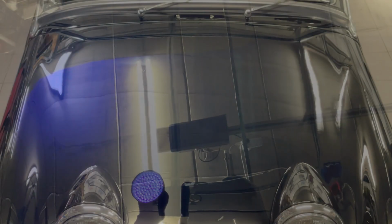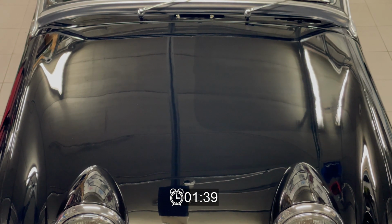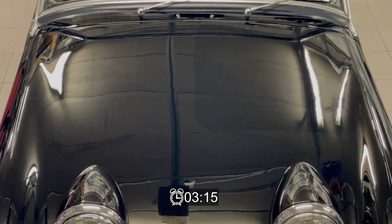The uncoated ones won't. Don't rush, but work at a steady pace nonetheless, to make sure that the product doesn't dry on you before you're done. The drying time depends hugely on air humidity and ambient temperature. A coating will dry faster in hot conditions than when it's cold.